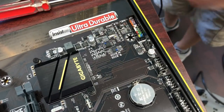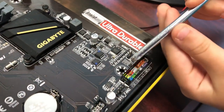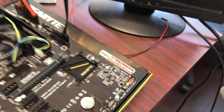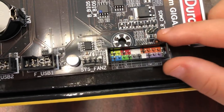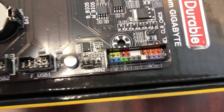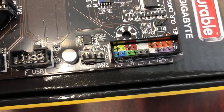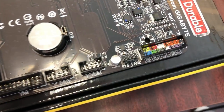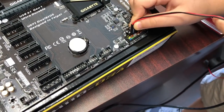The other way is to take a Phillips screwdriver and tap the metal part onto the two power switch prongs. For the header pins, look for the indicators on the motherboard: find the '+PW' and '-' labels — that's the power switch. Plug the positive to positive.